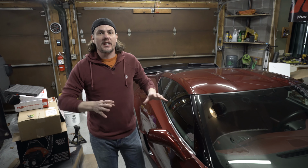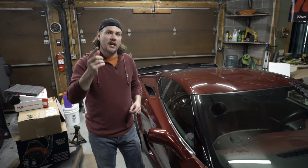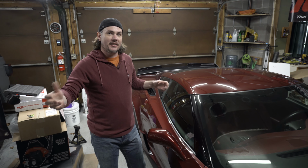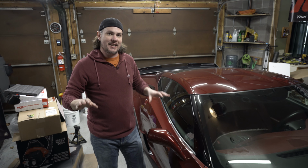Next, we're moving to underneath the car. You're going to have the big shield plate underneath there. There's 2 bolts that you leave in there. You'll see the slots, the rest you drop out, and it allows you to slide the shield plate out. It keeps it from dropping on your face, makes everything nice and easy.